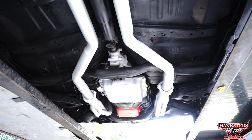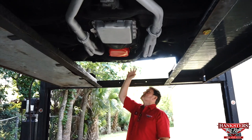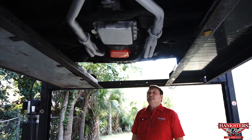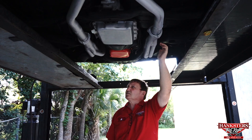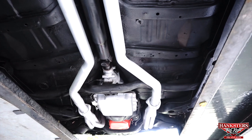No antifreeze in the front dripping. No power steering leaks. There are the hoses and the box and the pump. Engine's been out and refreshed. Original transmission cooling line still going forward to the radiator. Our long tube headers going into a 3-inch collector, into a 2.5-inch pipe. Frames in the front are box frames that transition onto C-channel frames that go the length of the car and then transition back onto the box frames in the rear.